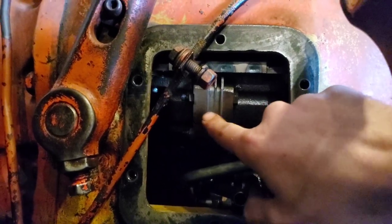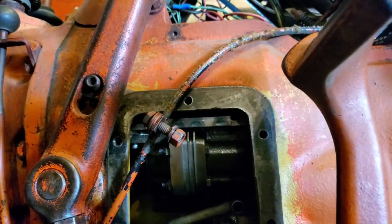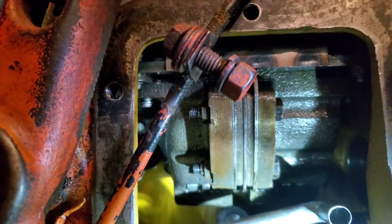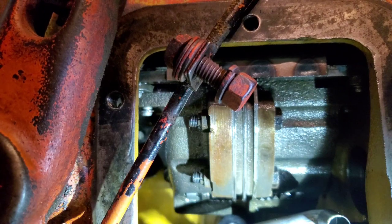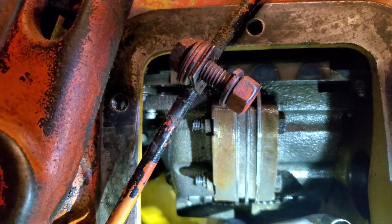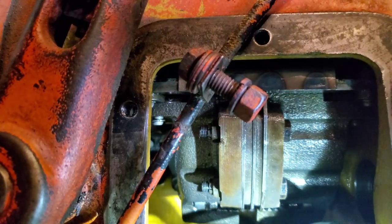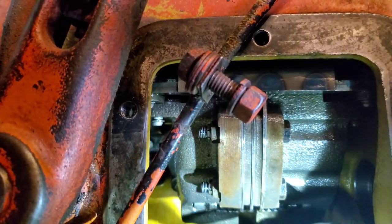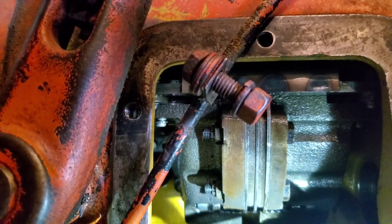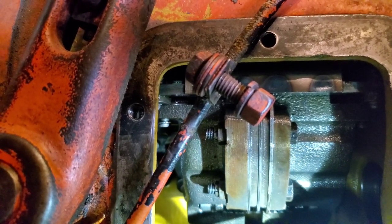Here are your shims — you've got three shim packs in there. The outside shim packs on a fresh clutch are going to start out at 85 thousandths. Most of the factory ones are numbered inside of there, so you can figure out how much of a gap there is just by counting them up. Some people make their own shims and don't label them, so you'll need a caliper to measure those.